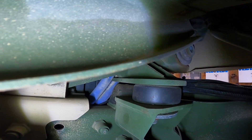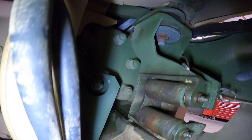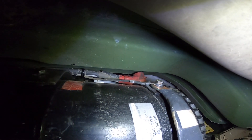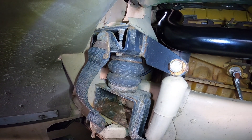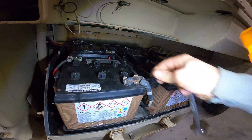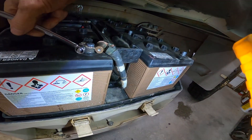I do have a pretty decent upper body mount, but if your upper body mount is deteriorated, there's not much tolerance on top of the alternator. So this is a worst-case scenario with the airbags deflated. Once you start getting a little air in there, you can see right away it lifts off pretty good. Let's hook up this ground.